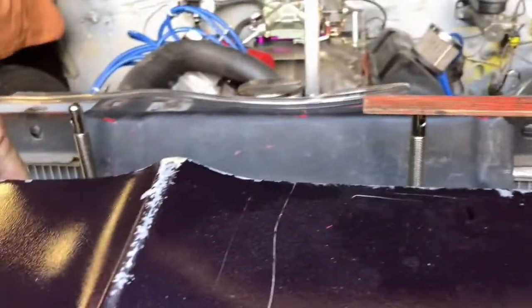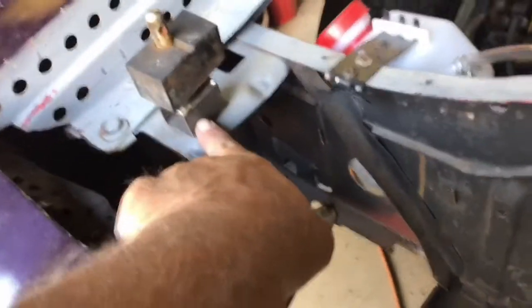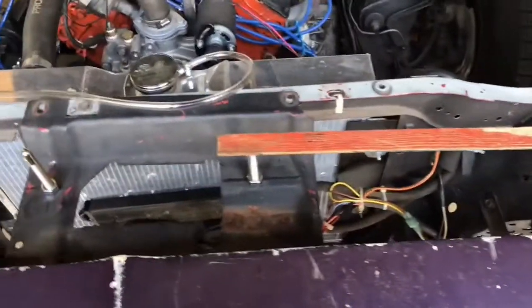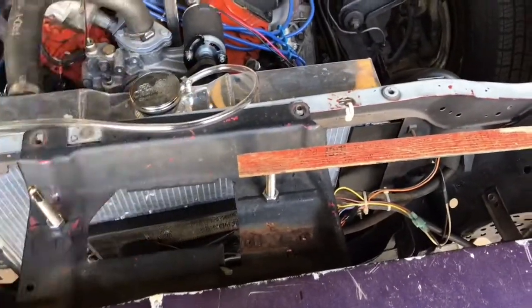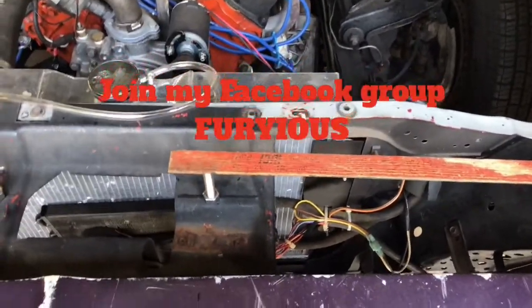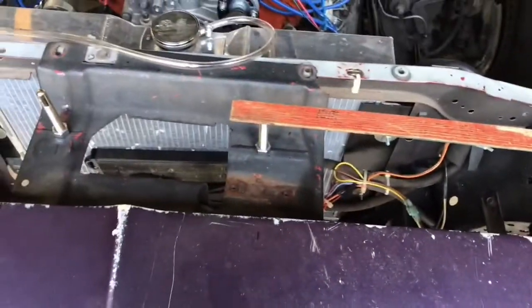This piece here was considerably lower. What I had to do on this one - I had to put these little blocks to raise these hood pins up. You see right there, I bolted those blocks down. So I'm going to do the same thing here - I'm going to have to cut some more steel and raise these hood pins up. They're too low; they won't even touch the bottom of the hood, won't stick through. Let me go find some steel.